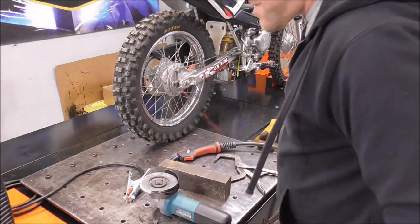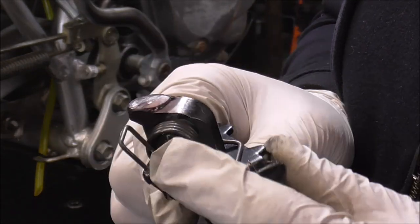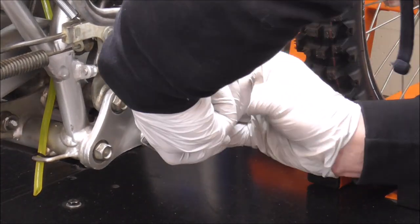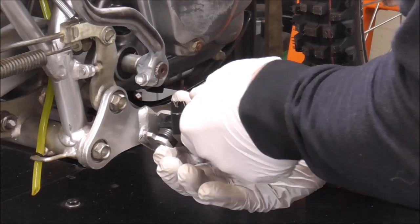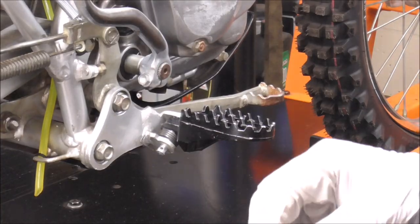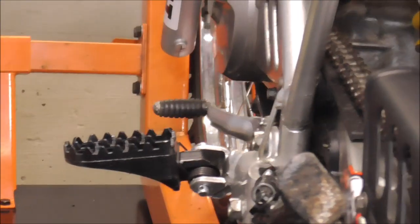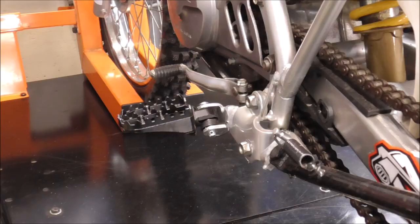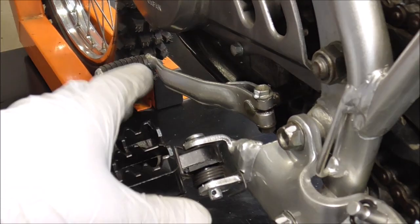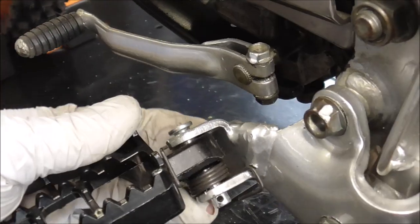There we go — that's it! I even touched it up with a little bit of black permanent marker so it has that nice look to it. Get the pin through, give it a little tap — look at that, nice. Cotter pin through it and we're in business. Now this left side of the bike is bad — compare it to the shifter, look how much downhill that is. That's the downfall sometimes when you buy these cost-effective imported things. It's going to have to come up a lot so we can build that up.